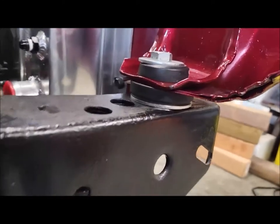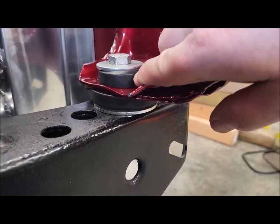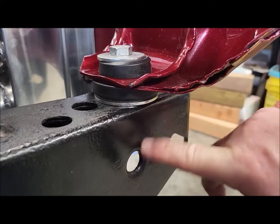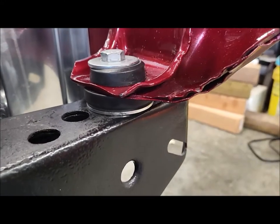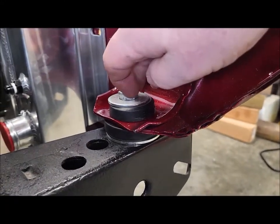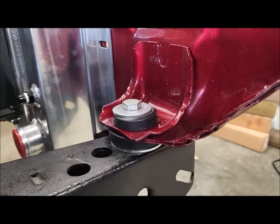There's a close-up view of the sandwiching effect of the bushings. The subframe side doesn't have a bushing underneath — you just put on the washer, lock washer, and nut, and you're done. I don't know the torque specs on this; I just torqued it down as far as I could for now and I'll deal with it later. I did the other side too, so that's done.